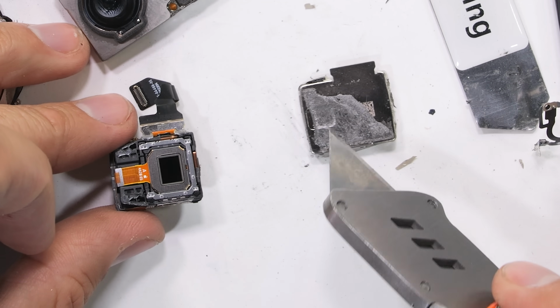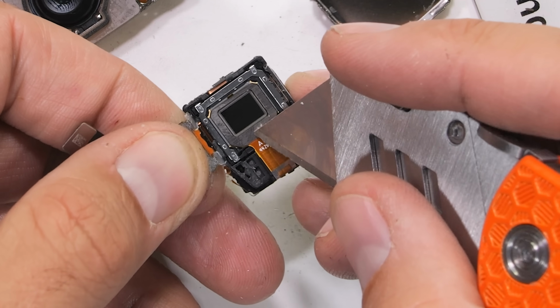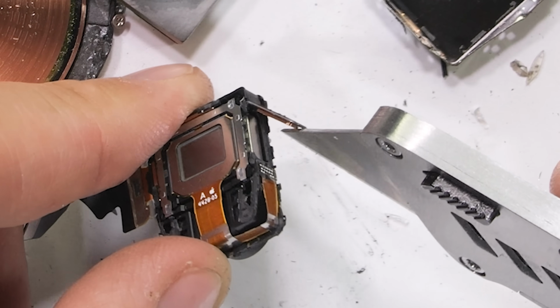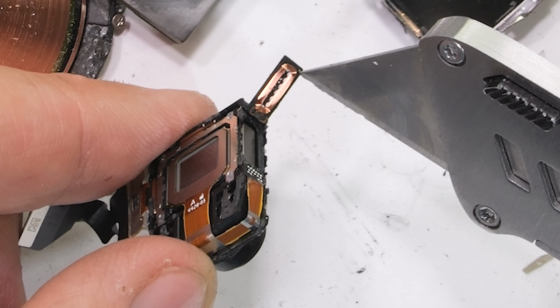With the back metal broken off and the camera torn into, we get our first look at the 3D sensor shift module. The camera sensor itself does the shifting just below the lens. The itty-bitty copper coils on either side create energy fields to attract or repulse the center floating unit 10,000 times per second, in true Street Fighter fashion.